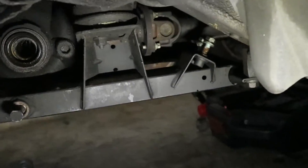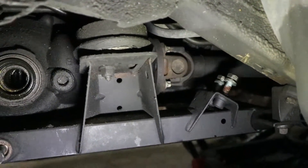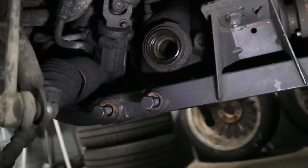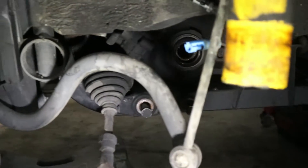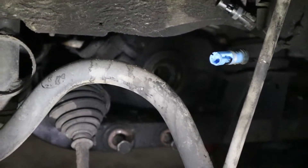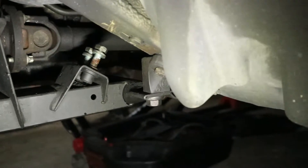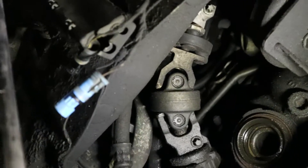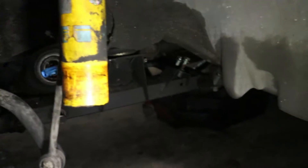We definitely need to remove the subframe to get access to the differential — you can see the opening there, that's the differential and the front differential shaft. This subframe is very different from the rear-wheel-drive car; the bolt locations are different. This one has one up here and a couple more back here. The factory rear-wheel-drive subframe has a mounting spot that is capped. If you're going to do a rear-wheel-drive conversion, you'll also have an issue with the transmission crossmember because the transmission tunnels are different.